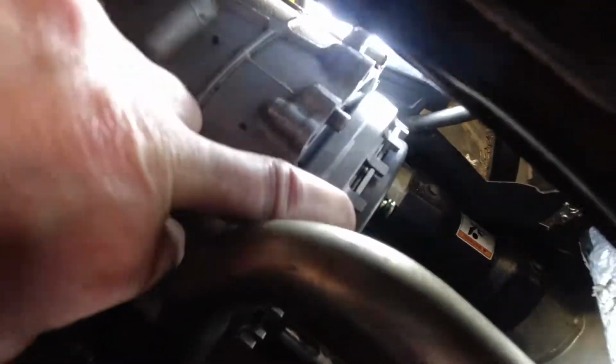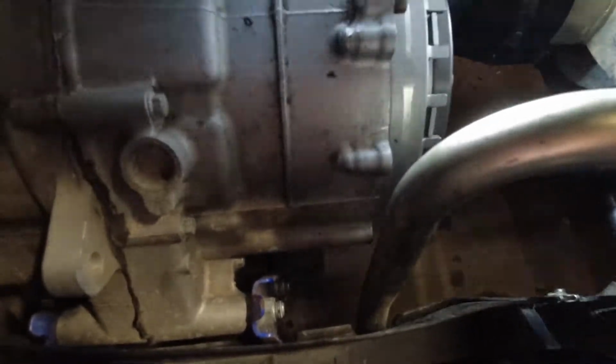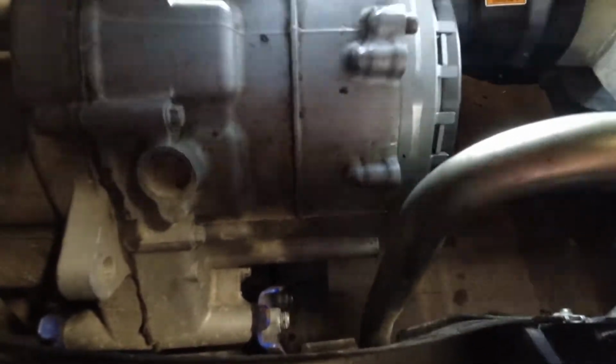So I thought, I'm not able to push against the hydraulics. Even with the springs on, it wouldn't go back far enough. So I took the slave cylinder off and it went back and clamped the plates. So I went to put the slave cylinder back on and I couldn't get the slave cylinder on.